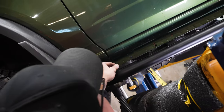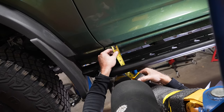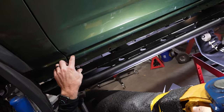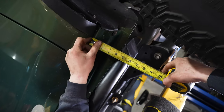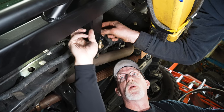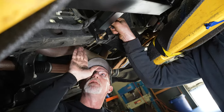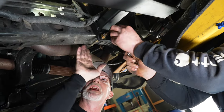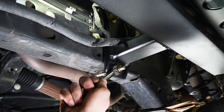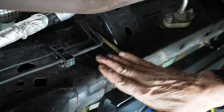We're measuring front and back, making sure we're the same. I like to use this body line right here, put my tape over the top. Right now I'm at four-and-an-eighth in the front. As we tighten it down, we're going to make our gaps even from this body line down to the top of the slider. Tighten up the hex nuts on the U-bolt going back and forth — don't tighten one down all the way. That way the back of your U-bolt is sitting flush up against the frame with no gaps. If you tighten the bottom side down, you can get a gap at the top back on your frame, so go back and forth evenly. We're making sure we have no gap back here, that the U-bolt is sitting flush up against the frame.